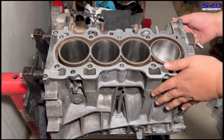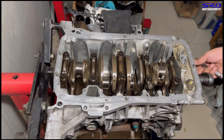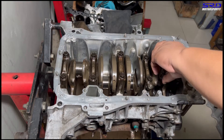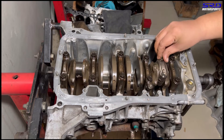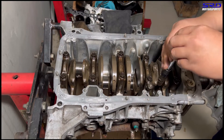Some people use a tapered ring installer, but when you do this often and it's a normal fit, it's easy. Now we put the rod bolts and rod caps on — we pre-lubed them off-camera. The initial torque step is 18 ft-lbs, followed by 30 ft-lbs, but for now we hand-tighten so we can assemble the rest.